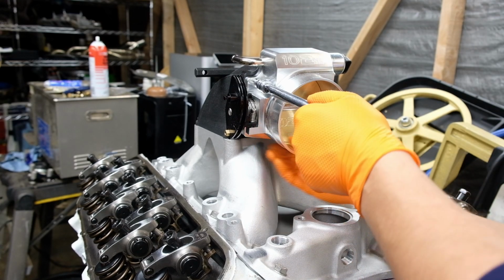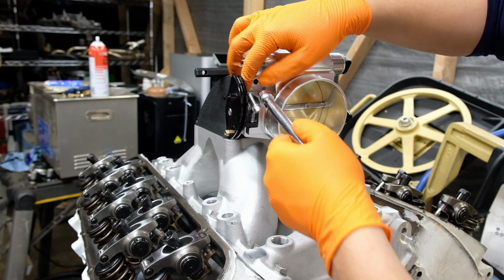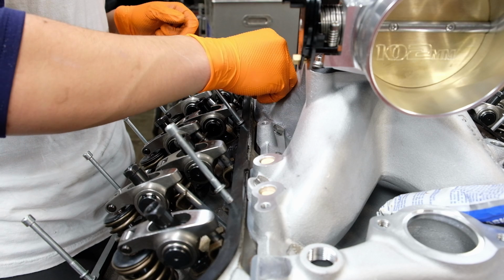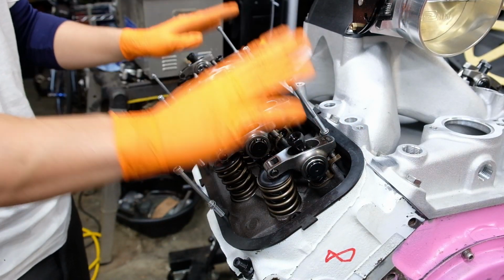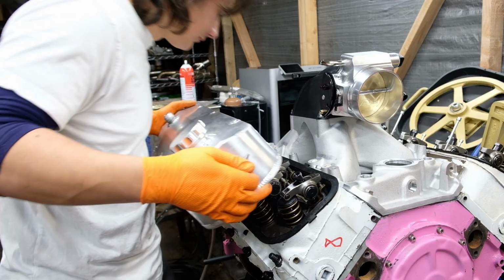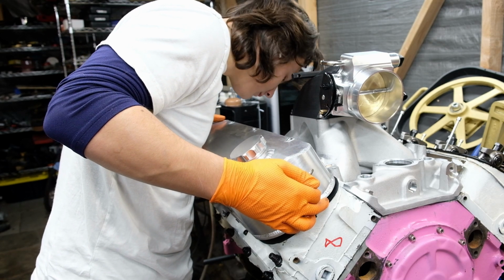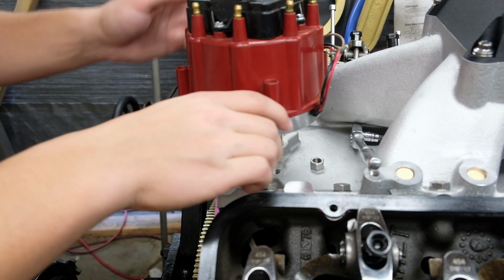Now, this piece isn't exactly done yet, but I wanted to seal the motor up while it sits in storage so nothing falls down the intake. These certainly aren't the right style of valve cover gasket to use with bolts instead of studs, but they work just fine with a little bit of sealant to hold them in place. The valve covers were my first real aluminum welding project, and it's also when I learned that pressing the pedal too quickly in AC will make the tungsten explode.